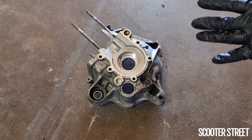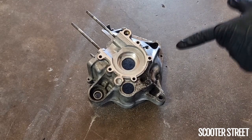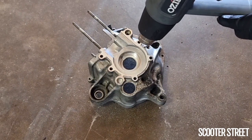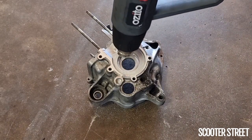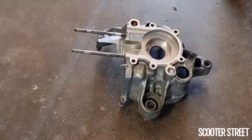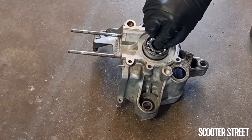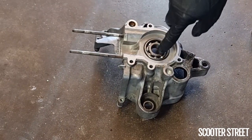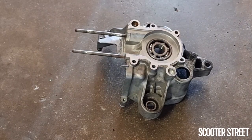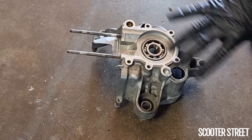So I'm going to go ahead and heat this up. I've got our bearings in the freezer. They should be pretty cold by now. Usually only takes 5 or 10 minutes with them. And we'll see how well we seat this bearing in. Okay, being very careful not to touch the casing. Hey, all the way in, straight away. Just going to let that sit because that's really hot, but that's made me look really good, hasn't it? The one in the 100 times that it just goes perfectly in.